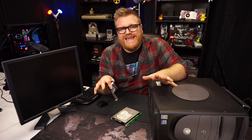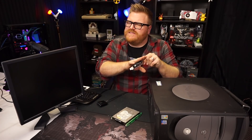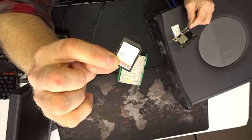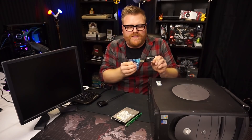Now you could use old CompactFlash cards — those are actually straight-up IDE, and there are different ones for that. But I believe those are a lot slower. Although there are some limitations to this, we're running with a much faster medium. This is an ultra 80 megabyte-a-second Class 10 SDHC card. I've written 4K video to these, no problem.